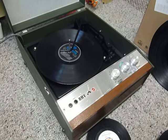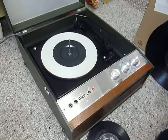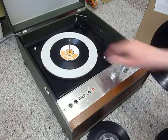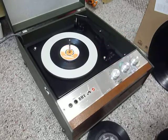If you don't use the auto changer and you just want to play one record manually at a time, you can place an individual record down the spindle onto the platter, with the stacker arm in the upright position. You can flick the switch down to auto and the arm will go across automatically, or select manual start and place the arm onto the record yourself.